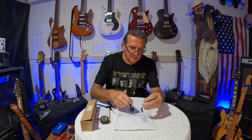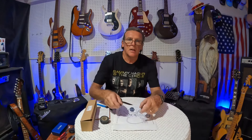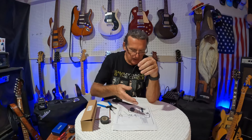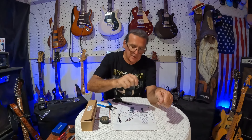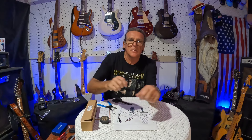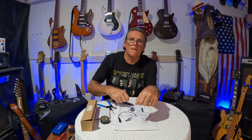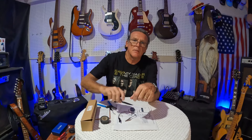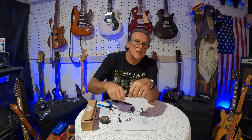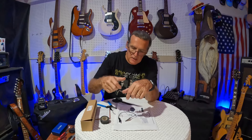Hook them on your lugs. Then get your diagrams and go — okay, the black goes to the switch — clip it, clip it, and just follow through. I use the same color wires that they're using on their pickups so it doesn't get confusing. Connect them all, take my input plug, plug it into the jack, and sit there with a screwdriver. Put it on the neck pickup — does it work? Put it on the bridge pickup — does it work? Tap on it. Put it in the middle — are they both working? Turn the volume down — nothing working. Turn it back up. Turn the tone down — get a softer sound. Turn it back up — get a brighter sound. If you're using a push-pull for coil splits, pull it and see if it drops in volume, then pop it back in.